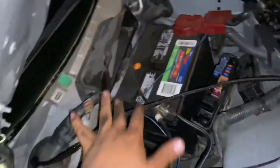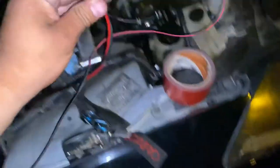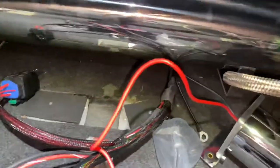So we basically figured out how to run the cables all the way to the engine for the management and the power supply. It was so badass. We found a little grommet right there to the carpet going up. We brought it up all the way over here. You do have to take off this plastic that covers the other fuse box right here. So these are the cables. The remote, we're gonna get it from the fuse 15 for the radio, and the other power, obviously battery and ground. For the USB, you can't really tell, but we ran it through there, down here, and you see the little cable poking out, but it's all the way out here. That's the USB for the controller. And like I said, we tucked the cables in through the carpet down there. We thought it was gonna be harder, but it turned out to be easier.